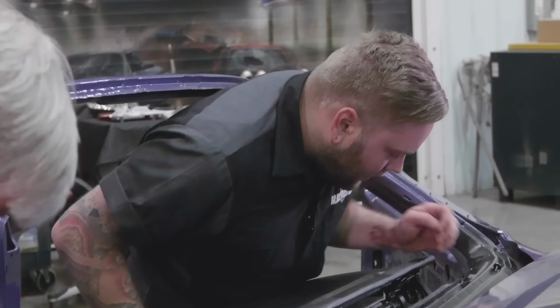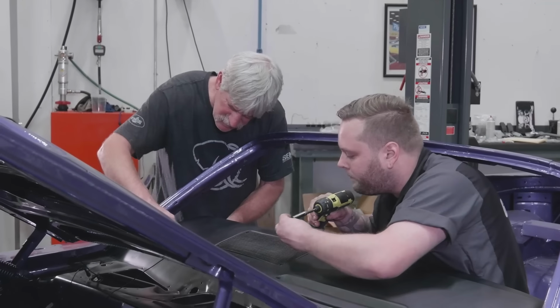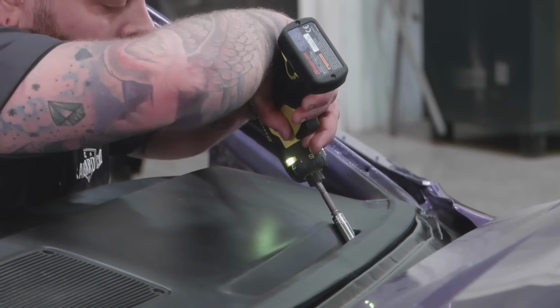Because you have bolts in the sides that go into the inner hinge pillars. You don't tighten them all the way down because that framework's going to come in and set down on it. You roll it up into place. You have 5 screws across the front of it. That all just seems very assembly line to me. So it wouldn't surprise me that the way we're doing it today is exactly the way they did it back in the day. It's a good, clean system and it works.